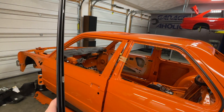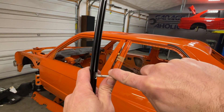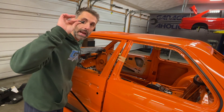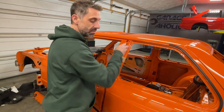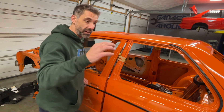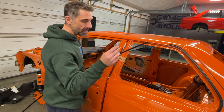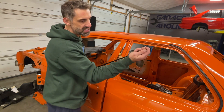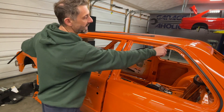You want to put one more right there. So this is like a chicken-and-egg scenario with this black piece. This is a trim piece that connects the C pillar trim with the rest of the trim we're about to install. The key is that there's a left side and a right side, because it flares out to meet the larger section. The key is that you need to put this on first, because it installs and then slides over. Put it on here, then install your trim piece, and then slide this guy over to connect everything together.